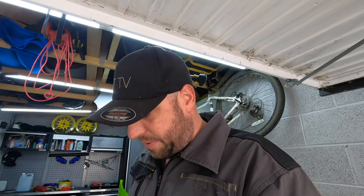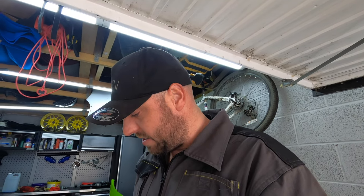Yeah, I'm a bit disappointed going back to the fact that I can't paint the underside of the car white today. But let's have a look around and a fiddle with what we can do. I might look at taking out the rear windows on the new shell, and then from there I can sand down the cage that's in there, get some metal primer spray paint, and then spray the cage with the same paint that I sprayed the steering wheel with.